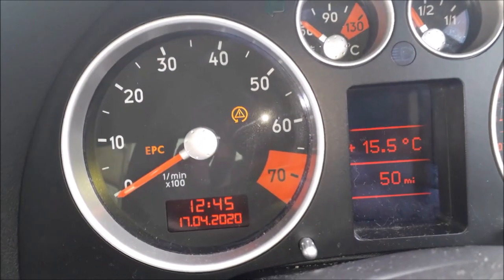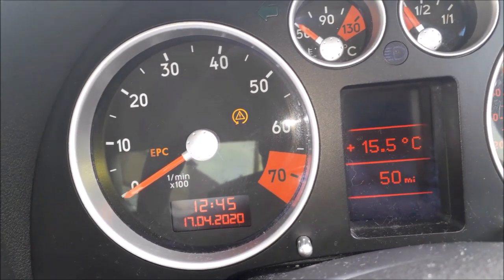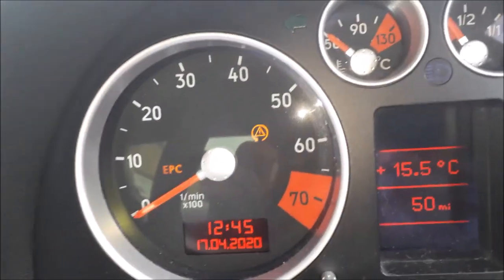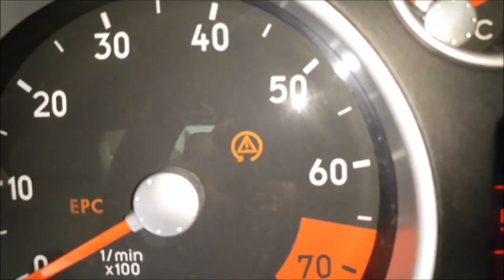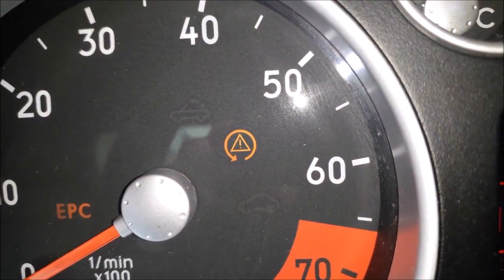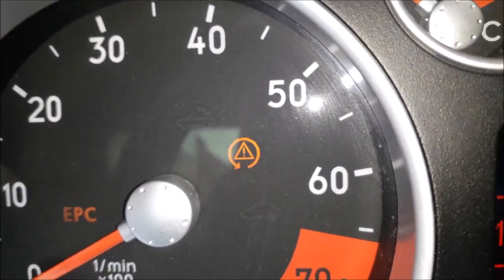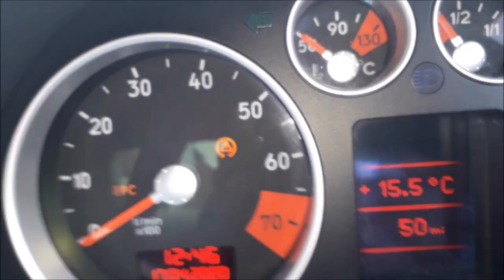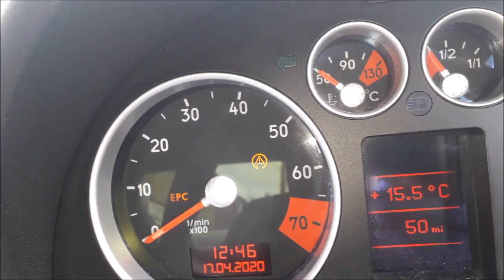As you can see, the light will now actually come on on the dashboard. It's a bit confusing, because basically what it means is when the light is on the dashboard, that means the ESP system is actually turned off. I know that seems a little bit confusing, because it's illuminated which might suggest it's turned on — but it's not. When it's actually on like that, it means the ESP system has been manually turned off, or there is a fault.